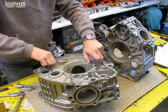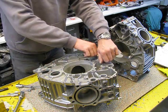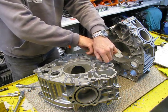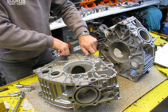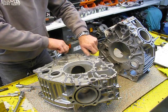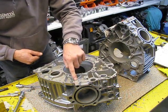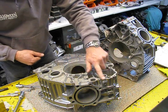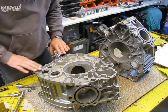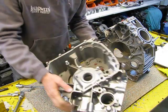If you paint it, please paint as little as possible inside the engine. That is the best way to do it. You see, this surface is not clean. There's paint on it, but inside also. I'm going to sandpaper it off, grind it off with sandpaper. All the bolts are not out yet. This one has to stick there. Look to the other side.